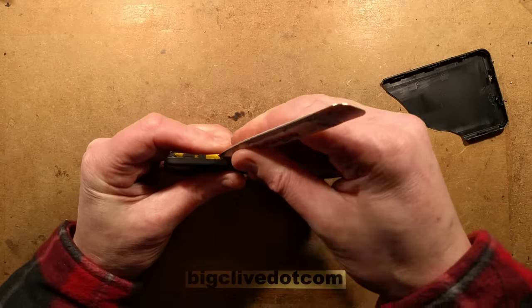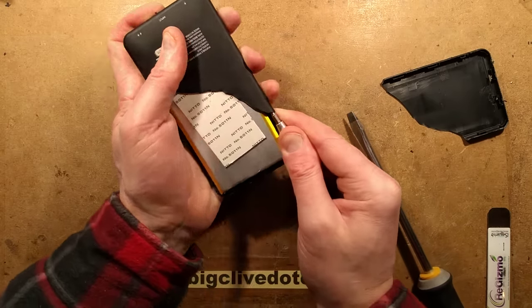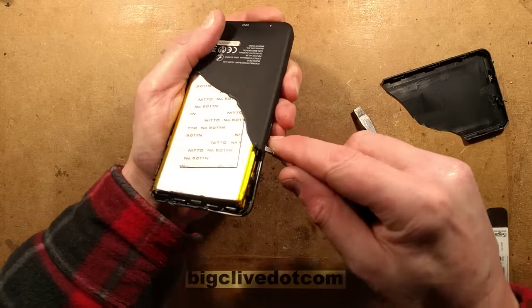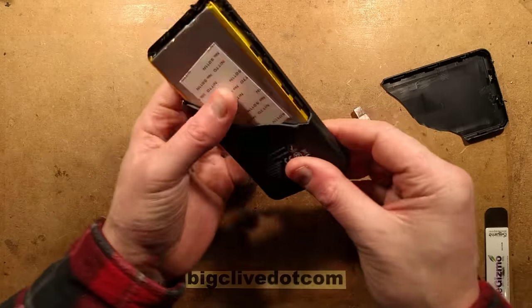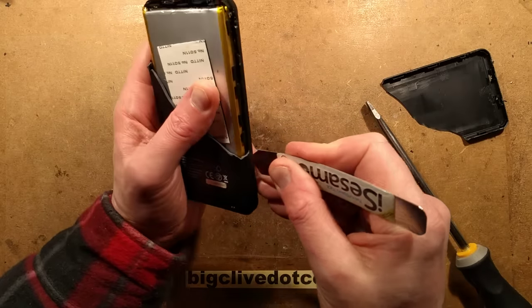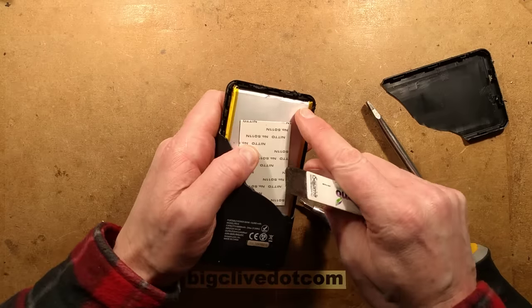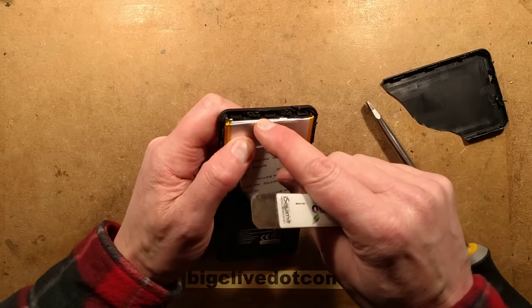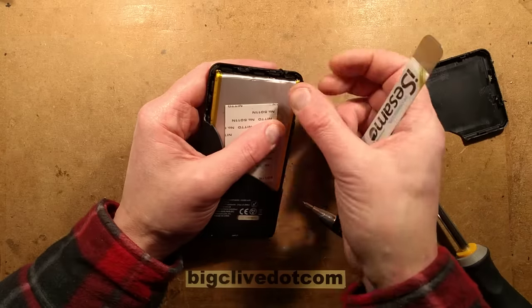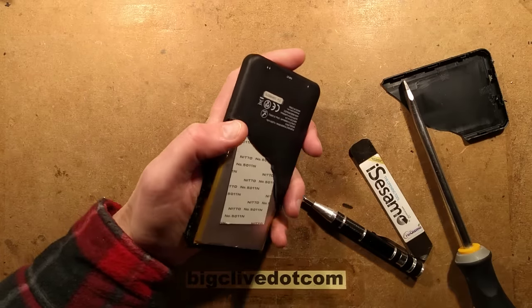This is such a tight case. I'll try to pry with a little screwdriver in the side. In the vicinity of lithium cells this is a terrible idea, particularly cells with a good charge - it makes it that bit more exciting. I reckon with the Samsung issue, they'd compromised the separator layers inside the cell - the electrodes made of aluminium and copper. They compromised the space at the end where the separator went to fit in as much chemistry as possible, then compromised again by fitting it into a case that was just that little bit too tight.